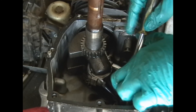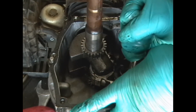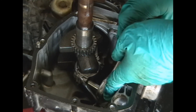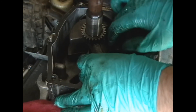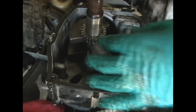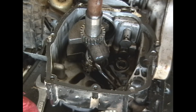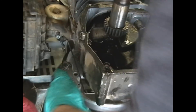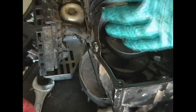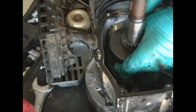So now I'm going to go ahead and pull the lower cap off. It's not on there too tight, amazingly. Bolt number one out. Bolt number two. Let's go ahead and see if we can pull the cap off — this guy might need some help with a hammer. The rod cap looks good. Set that aside. I'm going to go ahead and see if I can shove the piston through the cylinder. I'm just going to push it out like this with the motor — swing the crankshaft around just a hair more. There she is.